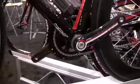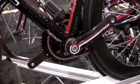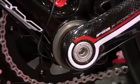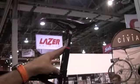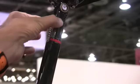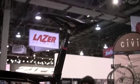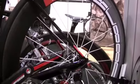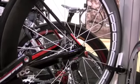Coming down to the BB, we're using BB30, which is pretty much a standard in the industry right now. That's the first time we have it also on the Team Machine. And we're using TCC on our specific seat post, which has got a similar fitting system as we use on the Stream Post on the RaceMaster. Also here at TCC, different carbon material mix. And we use the same spec on the seat stays in order to have sufficient compliance on this bike as well.